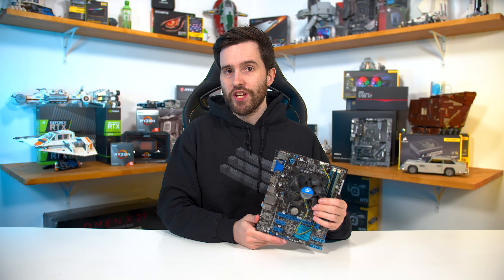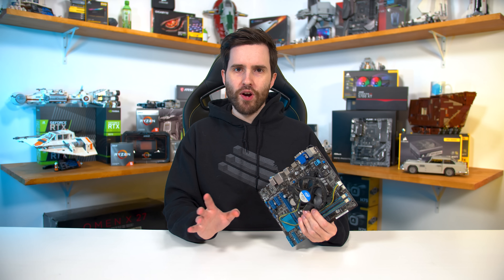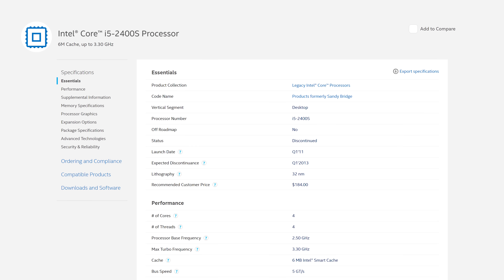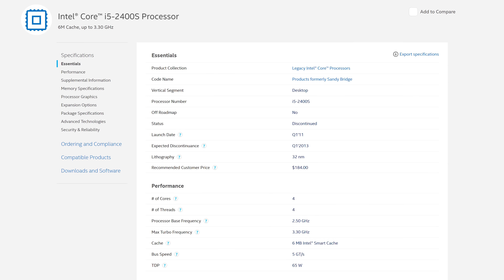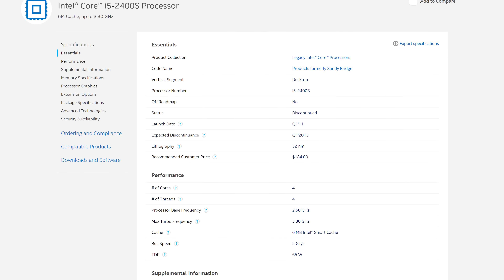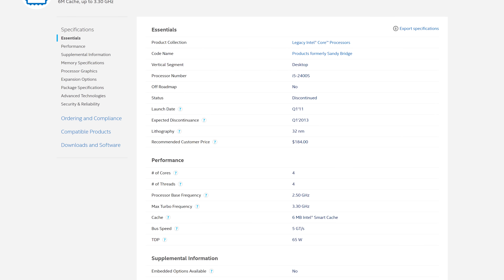The first issue is the CPU. It's almost embarrassing to say it's an Intel Core i5 2400S, picked up on eBay secondhand for around 50 bucks. This is a Sandy Bridge processor built on 32nm with just four cores and four threads — and it's not even the unlocked i5 2500K. It's the locked S model from one tier down, with a lower TDP of just 65 watts instead of 95 watts, giving a base clock of just 2.5GHz across those four cores with turbo up to 3.3GHz.